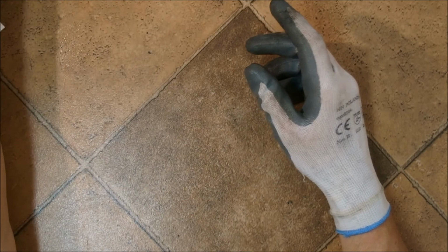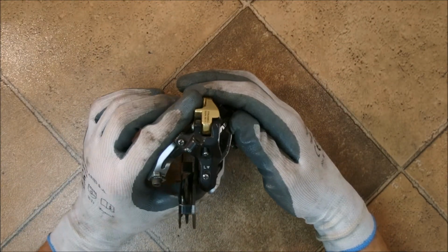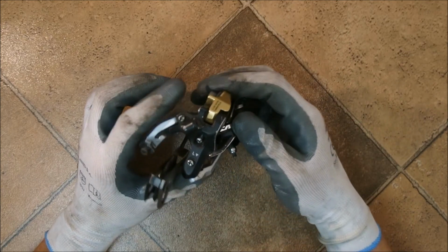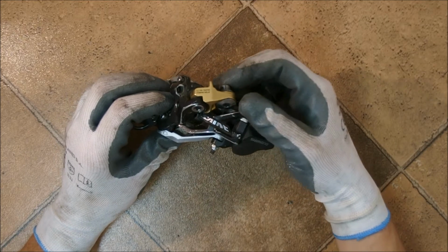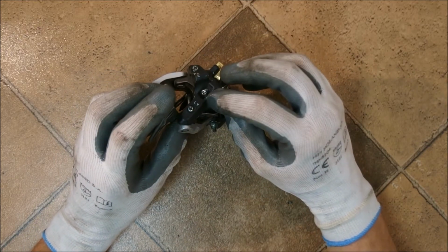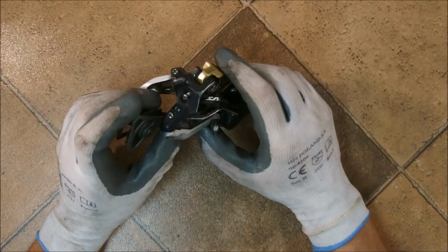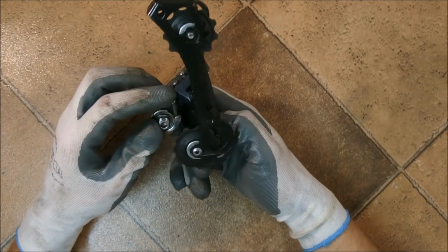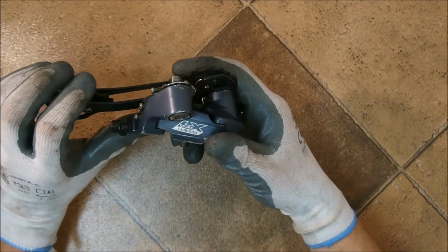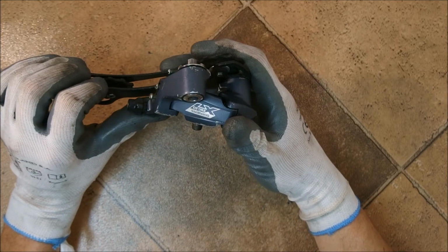When dealing with a single pivot derailleur, the B tension adjustment here is replaced with a B position adjustment. The difference being that in the single pivot derailleur, this adjustment directly sets the position of the derailleur below the cassette. However, on a dual pivot design, you are just tensioning the spring, so the derailleur will sit a bit lower, but it will also behave a bit differently.